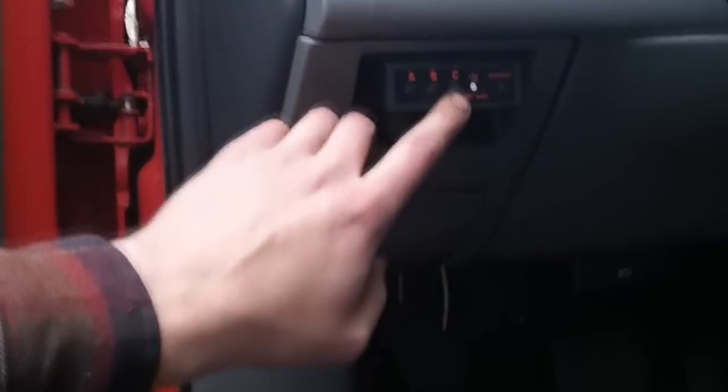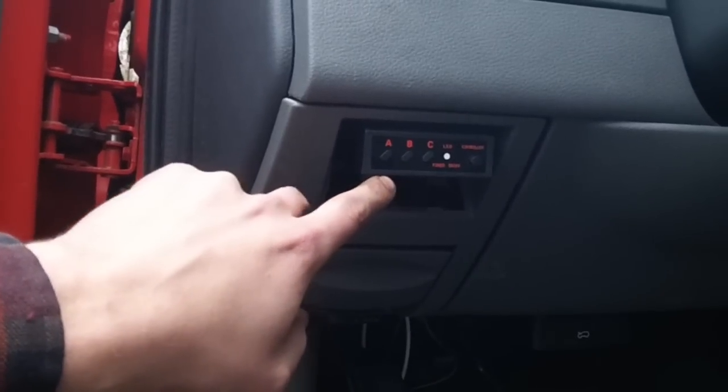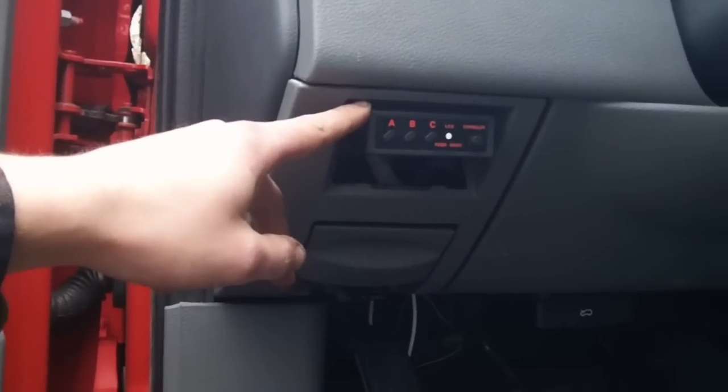From the inside, we have our control mounted right here. On this Dodge Durango, there actually was a factory spot here — our guess is it was probably there to add some sort of accessory. So we popped out the back piece and mounted this. There's industrial Velcro up above it so it's easily removed. And down underneath, you'll see where we came through the firewall with the homemade grommet, right there. Going to need to tie some cables up and get them all out of the way.